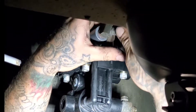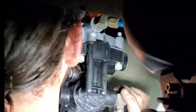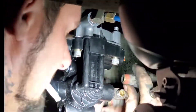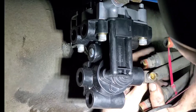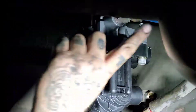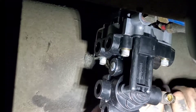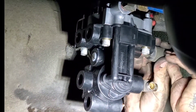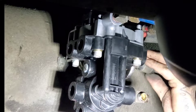The blue line is the service line and the red line is supply — make sure you put them in the right spot when removing. Take a picture and follow the steps. The black airlines are for the brake chambers: two airlines are for return and two are for supply. Zip tie and separate them so you put them back in the right spot. When putting fittings on, make sure you don't overtighten, because it's a plastic air valve and you can crack it.